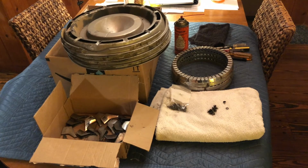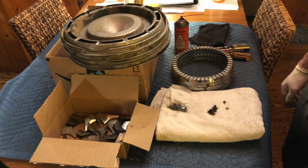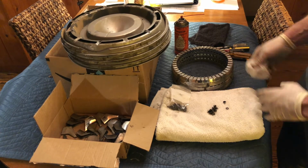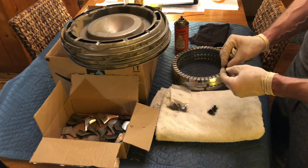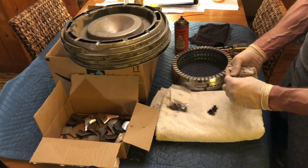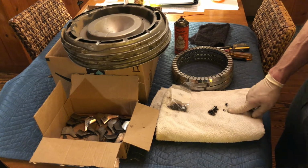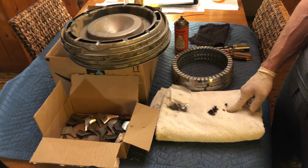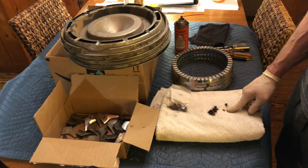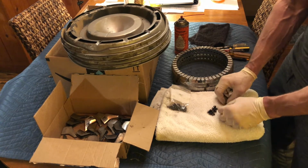Okay, we have success. I did manage to get all 4 of these hubcaps completely disassembled. Each part came off. And interestingly, I found one that was slightly different. One hubcap had stainless steel hardware and external tooth lock washers holding all the parts on. This applies for 1960 Buick owners only. There was a recall early on in the year. Owners complained of the hubcaps rattling as you drove. So this was Buick's official fix.